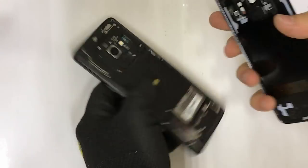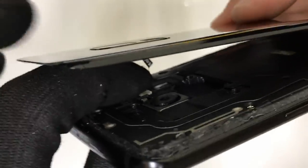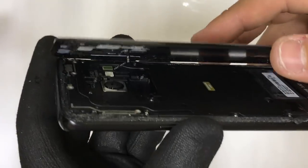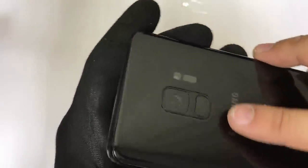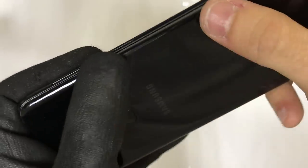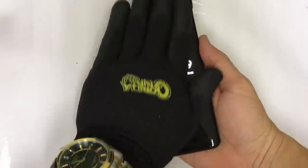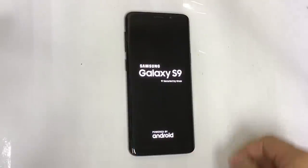Once you're ready, let's go ahead and place the back cover back on the phone. First, we're going to need to connect the fingerprint scanner flex cable — position it correctly on top of the connector and press it down until you feel it click. Then all we have to do is position the back cover right on top of the phone, position the corners first so that it aligns correctly, and push it down on all the sides, giving it some pressure so that it can glue back down to the housing. Please keep in mind that after doing this, your phone's waterproof rating will not be valid anymore. That's it for this video — I hope you enjoyed it. If you did, please give it a like as it really helps the channel out, and as always, I will see you around in the next video.